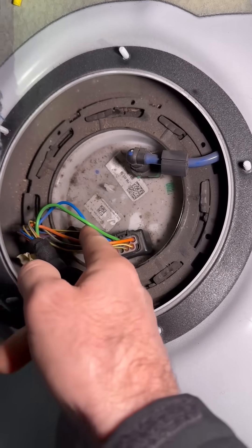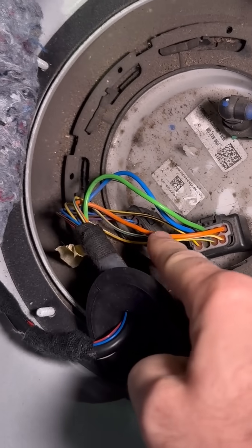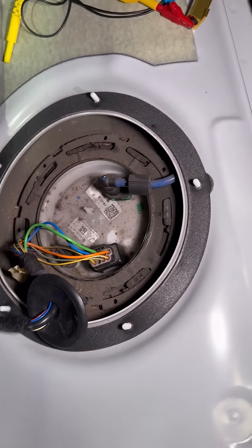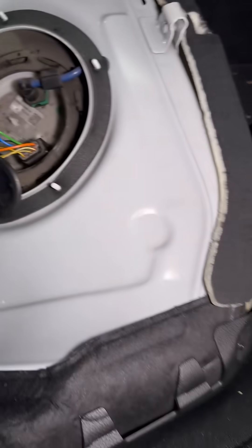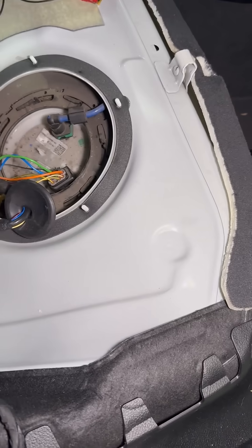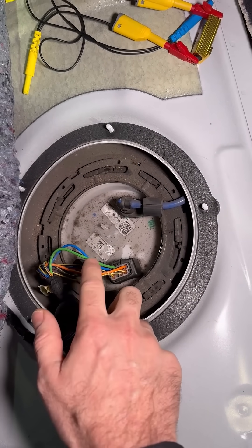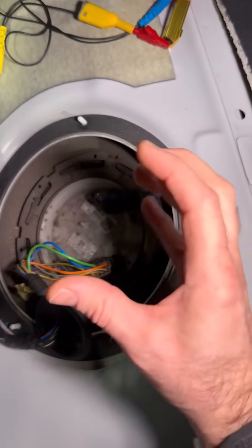Whereas on this three series you can see that there are three thick wires — essentially three power supplies. This is a three-phase fuel pump and it works in a very different way to the DC fuel pump, essentially pulsing a power supply in turn across the three phases to make the fuel pump spin. It's important that you know this because the way you test this type of fuel pump is very different from the DC type fuel pump.